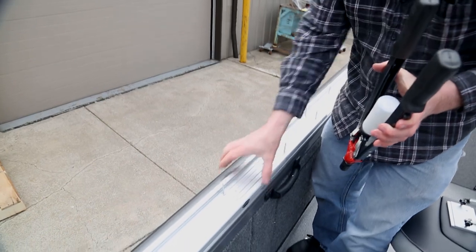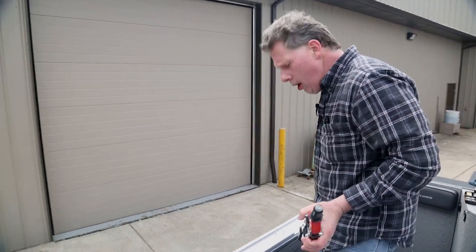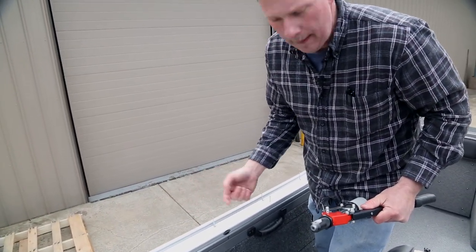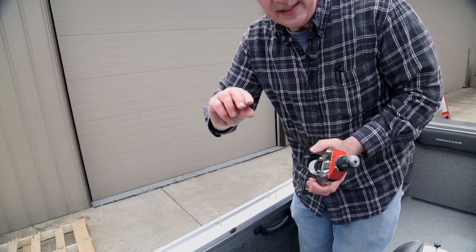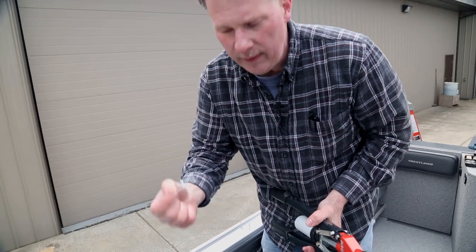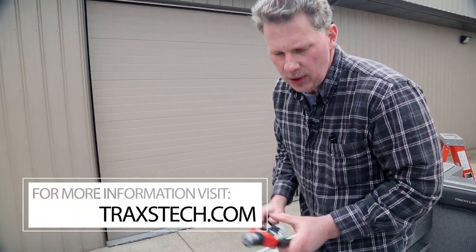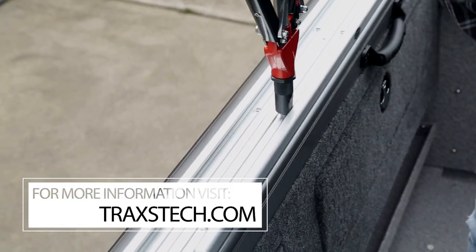Now that one rivet is in and that track is already just rock solid. We're going to go through and get all the rivets mounted down on this whole entire setup. It's important that we keep that rivet drawn up real nice and tight against the bottom side of that aluminum to really sandwich these things together. This rivet draws up and sandwiches in three locations around there at 22,000 PSI tensile strength per rivet — super, super strong rivets. All aluminum, so they match up to our aluminum tracks and we don't get any oxidizing between the parts. A great way of doing it — a quick installation and a really strong setup when we're done. Watch as we go down here and get this baby all installed.